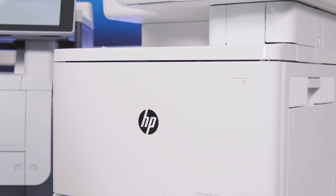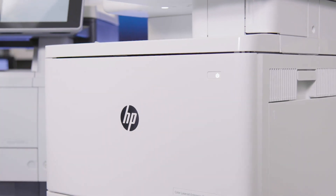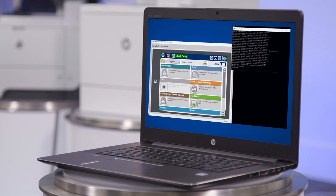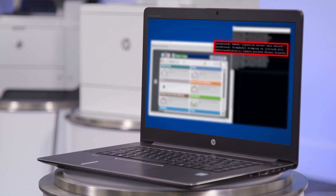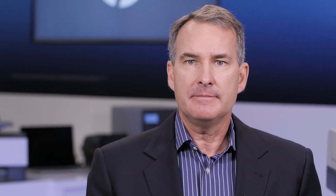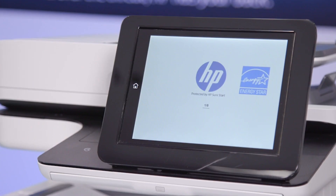Now, let's test the device with HP SureStart BIOS protection. Again, as the device is booting, the hacker has remotely interrupted the boot sequence and entered the BIOS. Looking at the computer screen, we can see that the hacker is injecting the same malware code as before, but this time, the control panel immediately shows that malware has been detected. We can hear the screeching halt of the scanner returning to its original ready position, while the machine sends a syslog error message that feeds the organization's threat monitoring system to alert the security team. You'll also notice that the printer is self-healing as it reboots, so that HP SureStart can check the BIOS and automatically reload it from a golden copy isolated inside the printer.